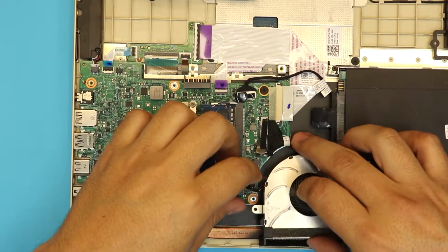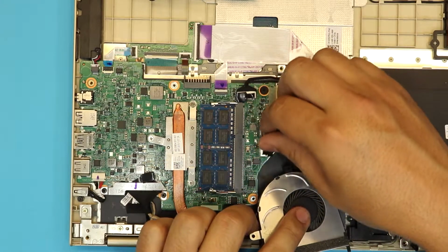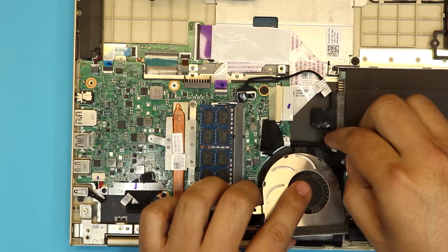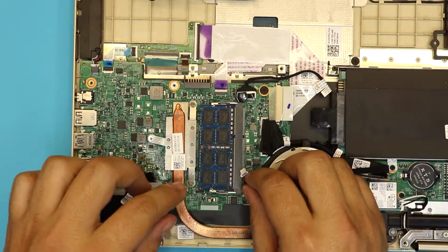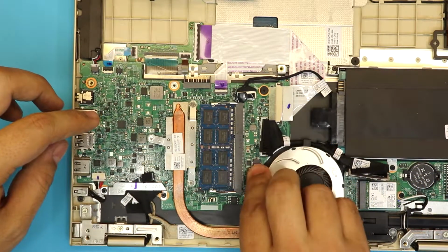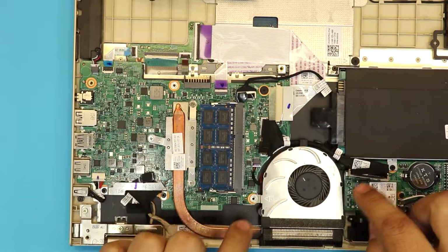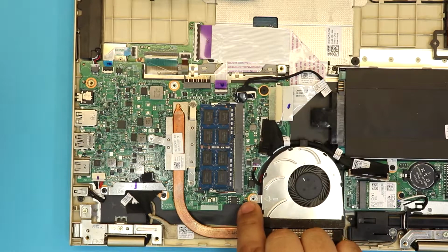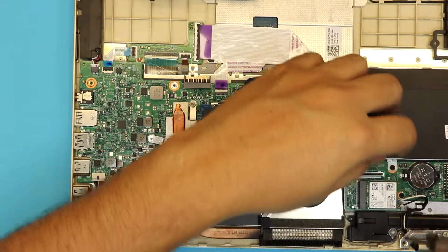And next, you want to put the fan right there, slide the fan right underneath. And if you don't want to remove this one, you can actually remove it, but I'd rather leave it there. I'm just going to run the cable right there. Put the jack in first. People always forget the jack. And then put the 2 screws. Remember, this is a flat screw head, and the other one is just a regular small one.